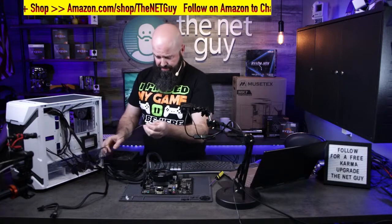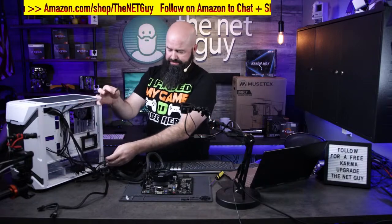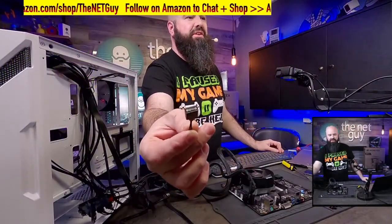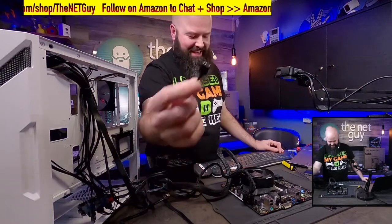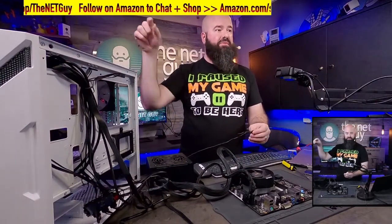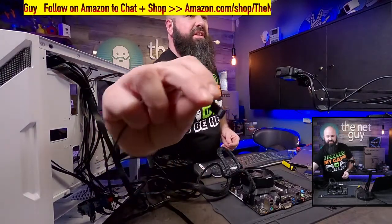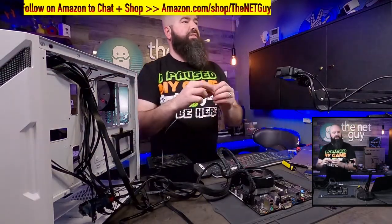If you were to buy the upgraded motherboard that I showed, you could actually plug this connector in. There's several different kinds here, but you can plug this connector. See those? There's a missing pin in the middle. That's how you know it's for data. It's a VDG plug, I guess. If your motherboard's upgraded and it has that, then it's addressable, so you can make each fan do something different. That's what the attachment is there for. And for different manufacturers, they have the other ones here. That actually even has the letters on it, doesn't it? VDG right there. That's voltage, data, and ground.